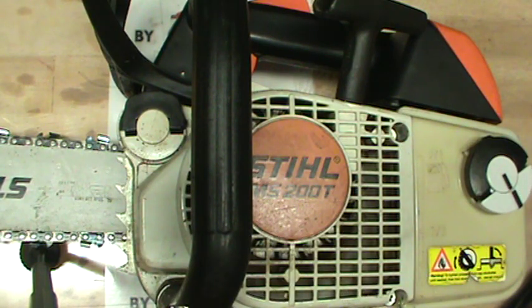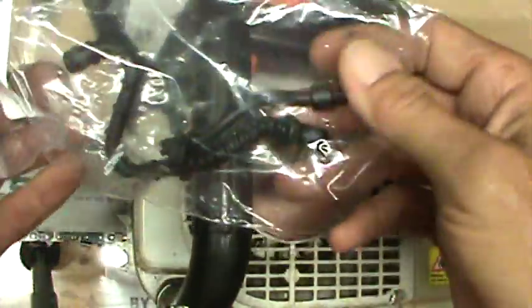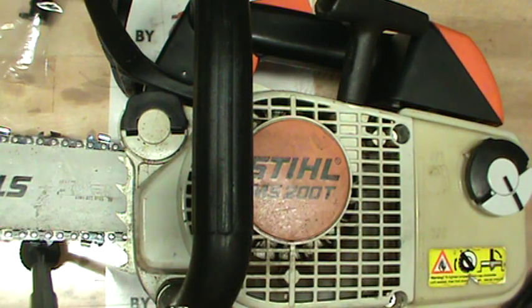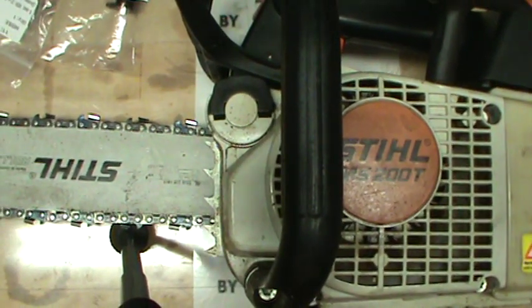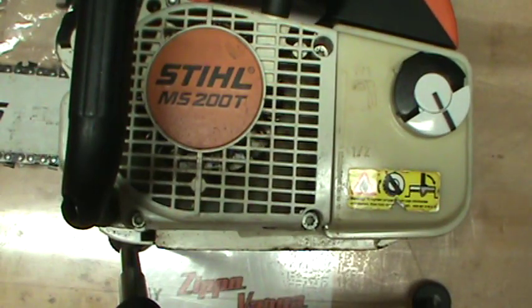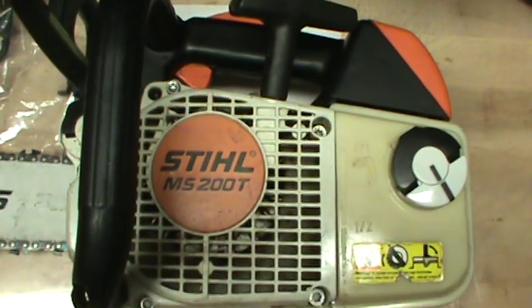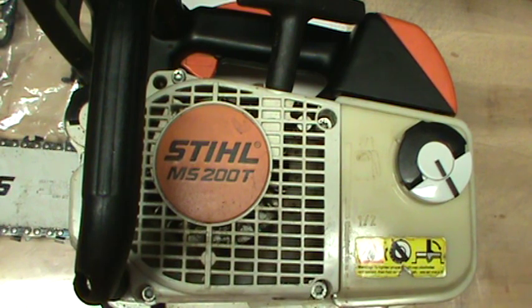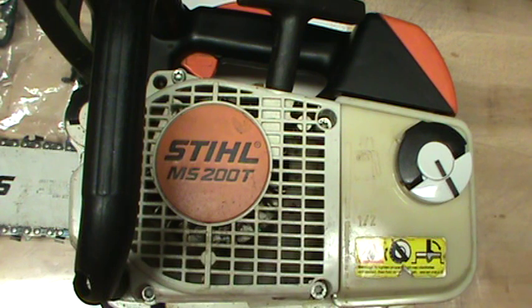Hey gang, I mentioned in one of my videos that I had a gas tank vent and fuel line to replace in my beloved MS200T because I thought that it was the reason for it bogging down. So I went through all of that time, trouble, effort, and energy, which, by the way, is no easy task, okay? You have to literally go down to just about the block to get everything out. The entire upper bale has to come off, your side handle comes off, pull cord comes off, everything has to come off. Carburetor has to come off, yada yada, so on and so forth.